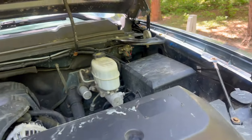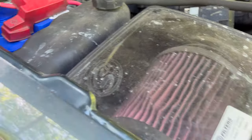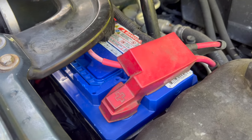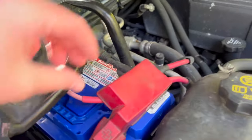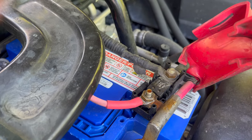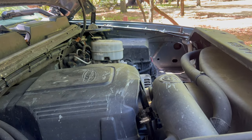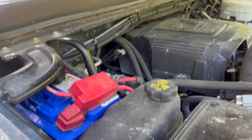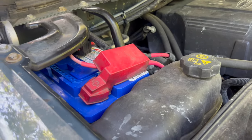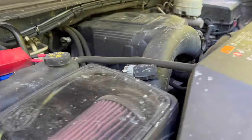Under the hood, the only change is the SMB cold air intake. We also have the X2 AGM battery — it's the 76 amp hour deep cycle battery. There are no accessories connected to it except for one wire. At one point I ran a dual battery with an isolator, but we started noticing voltage issues. Over the winter I made the switch to a full Redarc second house battery with a BC-DC instead of the isolator.